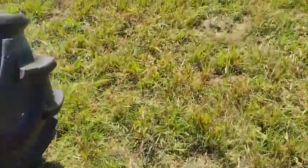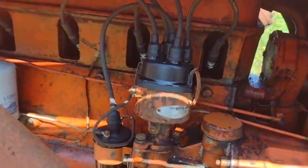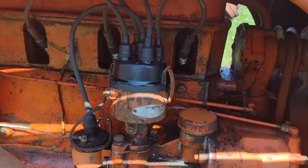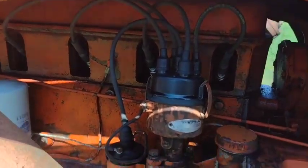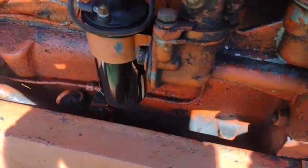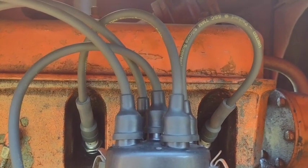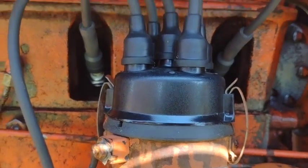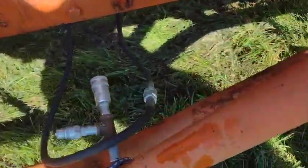It's not possible to tell the condition of the engine since it's not running. Assuming it's free, it's really best if you can at least bump the starter a little bit or get someone to tow it just to see if the engine will spin - but we're not set up for that out here. It does have some newer parts though - a newer cap, newer coil, newer wires - so it looks like somebody was really trying to get it running. If you look at an older machine and the cap is all oxidized and brittle and the wires are rotten, that's a sign it's been sitting a long while.